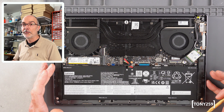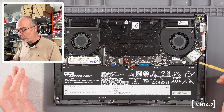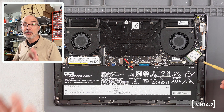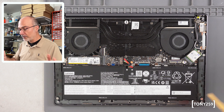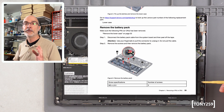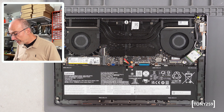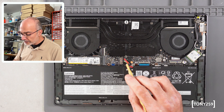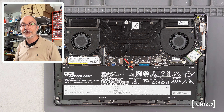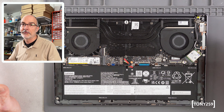I've opened this laptop on camera before — it's on my second channel. A few of my viewers said I repasted the laptop without disconnecting the battery. I completely forgot, to be honest. Someone said it's totally fine if you're just repasting, but I think it's a good idea to disconnect the battery — it's even mentioned in the official Lenovo hardware manual for this machine. Whenever you open the laptop, just disconnect the battery. And Lenovo says do not pull the wires, just use your fingernails to pull out the connector. So I'm going to follow Lenovo's advice and disconnect the battery, because when the battery is on you clearly have some standby voltages running around.